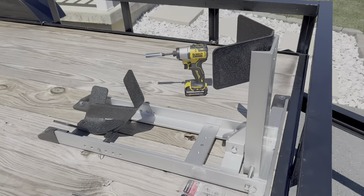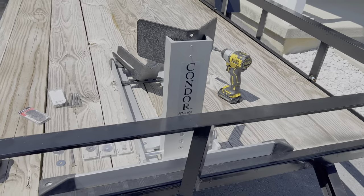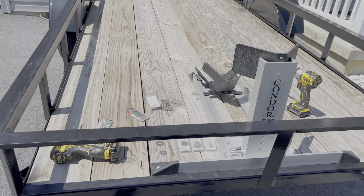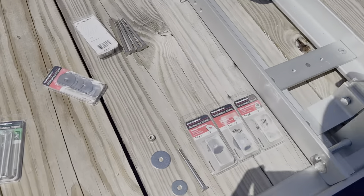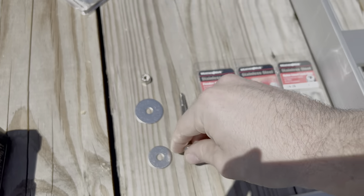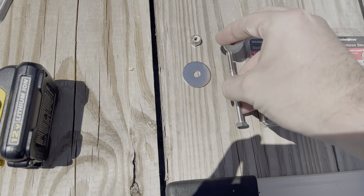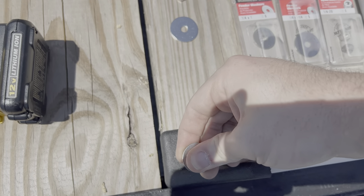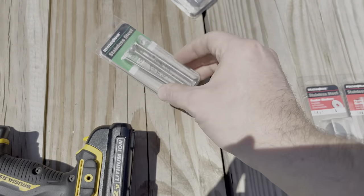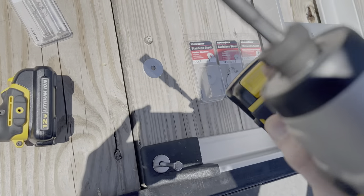I've got it in the trailer now. A lot of these trailers aren't made perfectly even — as you can see, the front center bar on mine is actually slanted a little bit, so center it up as best you can. For the hardware I used: all stainless steel — a 3-inch lag with a hex top, and then a quarter-inch by one fender washer for the top, with a quarter-inch hole drilled. I went with these instead of a flathead with a countersink, because a lot of times you end up stripping those out if you're not careful.